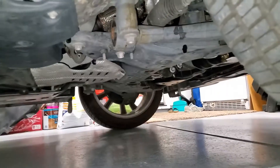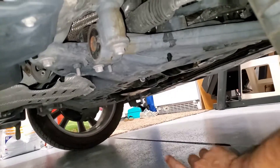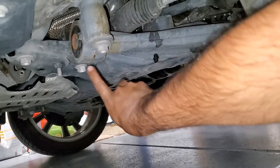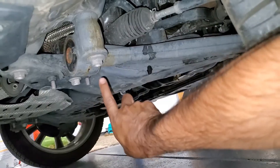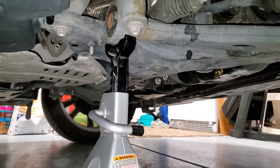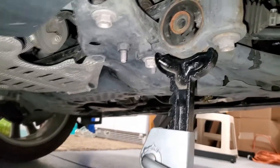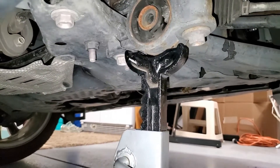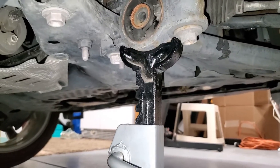Now that we've got the vehicle jacked up, we are going to support it with one of the stands right here. This is where the lower control arm comes in and attaches to the vehicle frame — attaches to the front end frame on this side and the main frame on the other side. I've got the jack stand located underneath, centered on the support, and we're going to go ahead and lower the car slowly onto the stand.